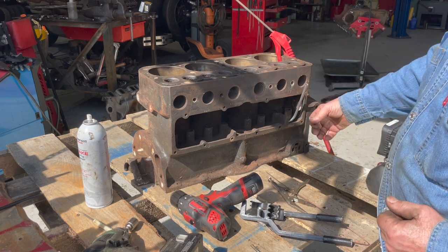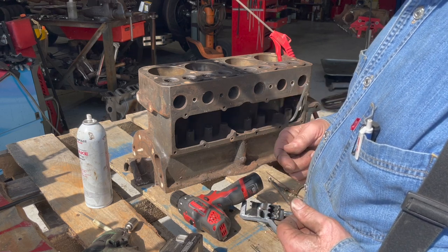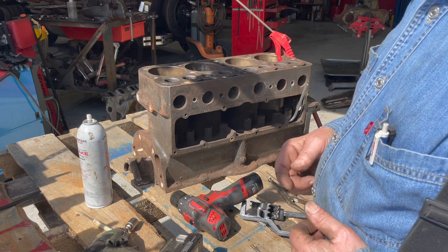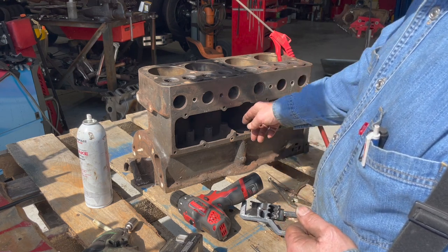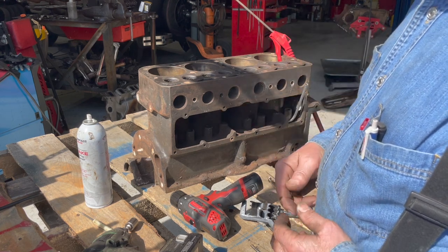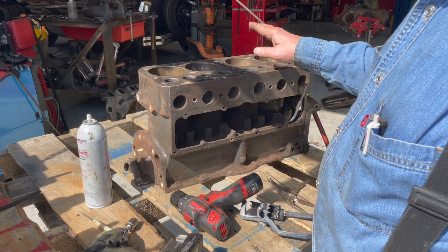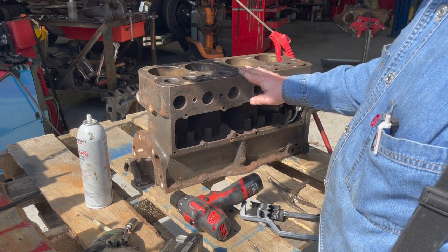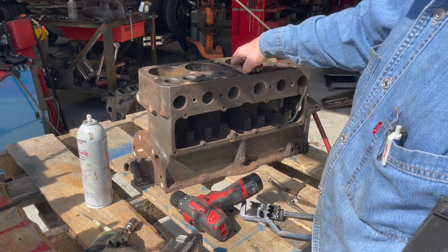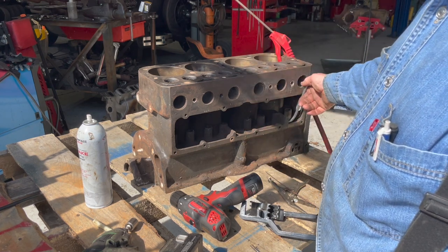I'm going to come out the side here. I've got a remote oil filter, and I'm just going to rig up on it so it can tell how much oil is coming through the filter. I'm actually going to use the original oil pump. I've got no cam in it, but I'm going to put a head on it and drop a distributor in it, and put a drill on the distributor to turn the oil pump to see how much oil comes out of this tube.